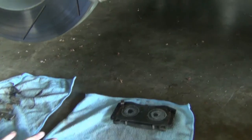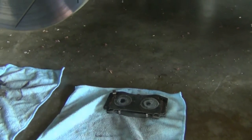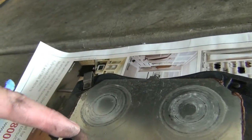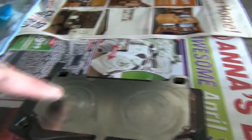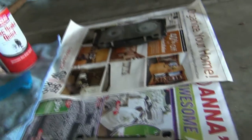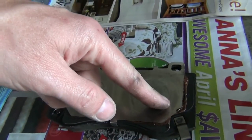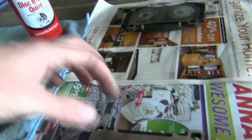I'm going to keep them organized — the inside pad on the inside of my blanket and the outer one on the outer — to make sure I don't get these mixed up. On the stock pads you can see the copper anti-seize under this plate. This one is probably okay but I might change it since it's out anyway. I've got the disc brake quiet spray, which is really good — I've used it for a long time. It's extra sticky and stops vibrations.